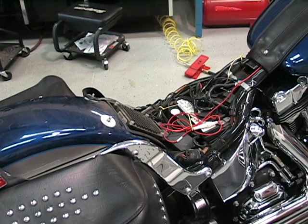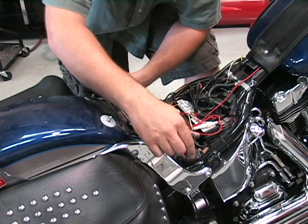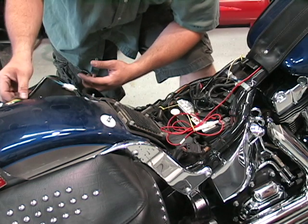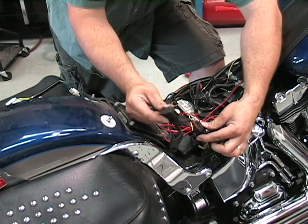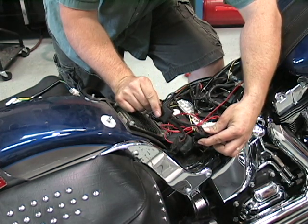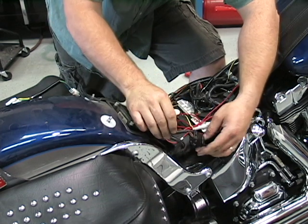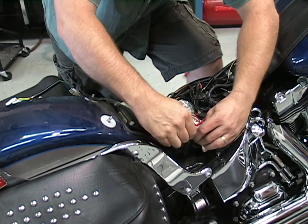So let's get to the installation. I've pulled the seat on this Harley Softail and located that plug. I'm going to open this plug and insert our sub-harness here. As I was looking under the seat, I found something important to note on Harleys. You see this little extra module? This makes the turn signals on the bike light up as running lights, and it plugs into the same plug as our sub-harness. We need to go in front of that, so I'll plug our relay system in front of this adapter — but they can go together in series.